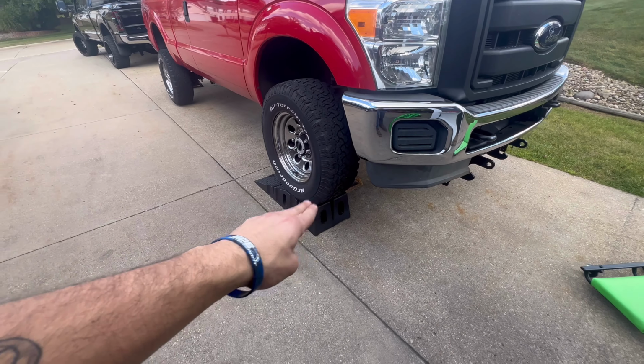So we're going to show you these covers now. All right, guys. So I'm just going to read off the box for you to show you all the good stuff. You got a magnetic equipped fill plug, which is cool. Magnetic equipped drain plug, which a lot of stuff doesn't come with that anymore, which is nice. 5/16 socket head cap screws. I'm sure they're stainless. These will be torqued to 35 foot pounds. Make sure you guys do not over torque these covers. 1/8 inch MPT plug installed. Obviously the heavy duty cover, and then 12 flat washers, which will go with the socket head. So same for this guy, the Allen head bolt. You got the magnetic plugs, same stuff.